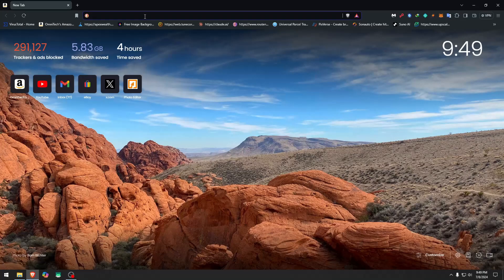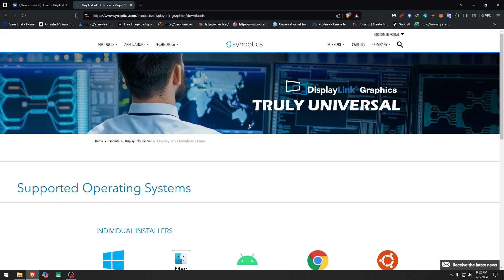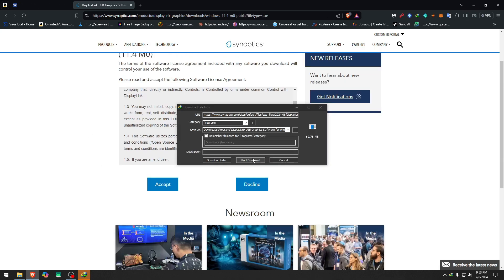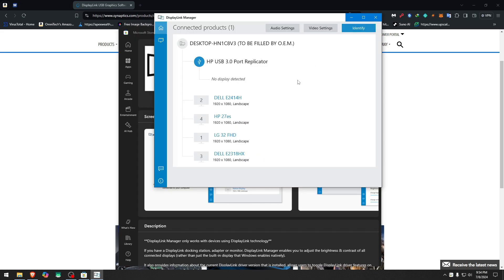To download the drivers, go to wavelink.com/driver. Search for the product and model you have — in my case the WL-UG63PD13 Pro. Here are the drivers — download them. It should be drivers for DisplayLink, which makes sense. Select the individual installer for Windows and the official drivers, hit download, accept, and open when prompted. You should start installing. If you already have DisplayLink graphics installed, just hit upgrade since this is a newer version. Hit finish and you are good to go.